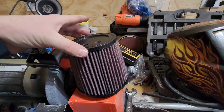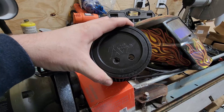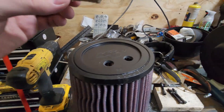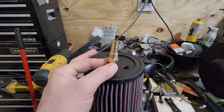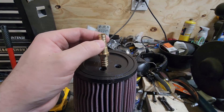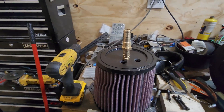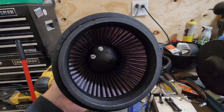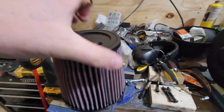The final step of making the PCV system work is to drill holes in the air filter for the intake. I did two half-inch holes and inside these holes I'm going to be using bulkhead bungs. I'll put these in through the other side so they're face up with the nut on the outside and the one-hole piece on the inside. This way when you put your hose on here it'll clamp down and there's no chance of that nut going through. If you put it through the opposite direction and that nut comes loose it could go into your intake, go to your turbo, destroy everything and cause all kinds of havoc. So just keep it all clean and don't put anything inside that you're not sure will stay put.